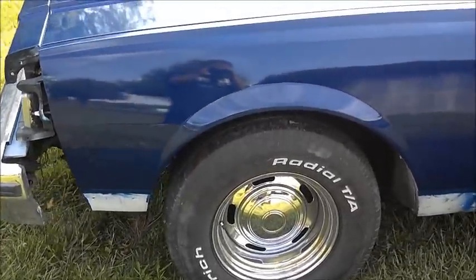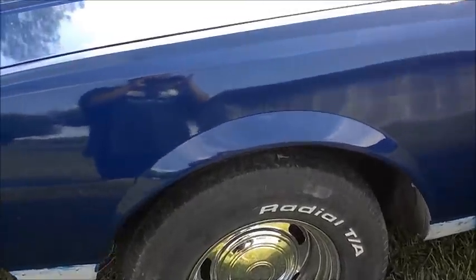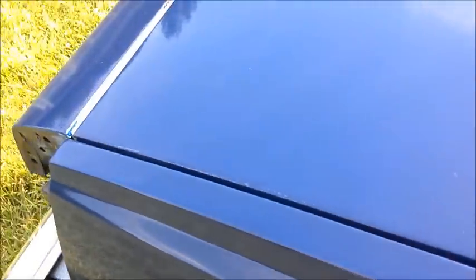On this fender right here, I just got done with that a little while ago. I done the fourth coat about two days ago and then while I was painting the hood, I didn't want to hit this little area right here on the fender because usually it will tack up and then it would just look a little bad after you go back over it. So I didn't want to touch that, so me like a dummy, I put a piece of tape going across the whole thing like that. And then after I painted that, I pulled the tape off not thinking and some of the paint lifted up right in here — all the way to the primer. I don't know why, but I guess the paint was still fresh and it pulled it up.